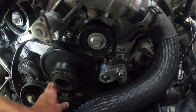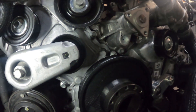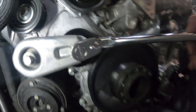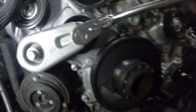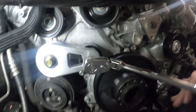If you want to pair it with an upper pulley — either conventional or clutched style — you can make even more boost, but this 20% overdrive lower will give you four pounds on its own. With the 20% lower, we do have quite a bit more space with the stock tensioner. You could get away with just going to a smaller idler pulley, but you're still not getting the benefit of the improved angle and spring pressure of the billet VMP tensioner. The billet tensioner gives tons of swing, a nice billet aluminum idler, very fast responding, lightweight, with lots of travel in the whole setup.